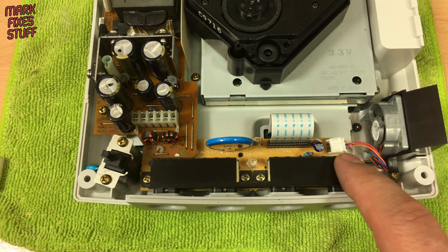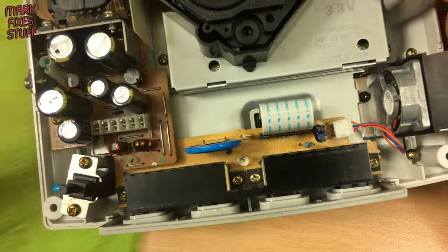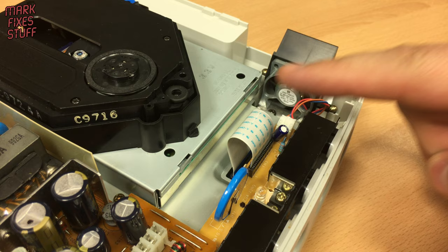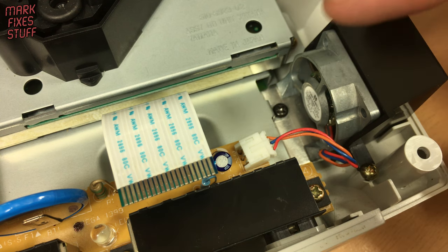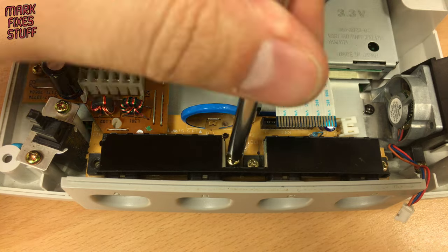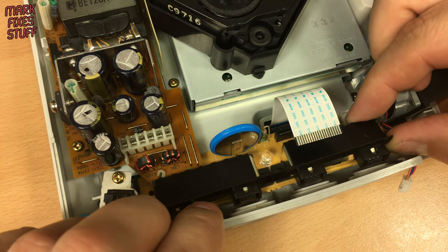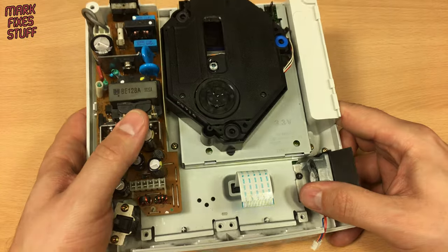We need to take out the controller port board. Pull out the flat cable — it's best to do this from the board side so it's not in the way when we're soldering. Next, remove the fan connector cable; this is locking so it might be a bit stiff. There are four gold screws. Now the board will come free, and the rest of the Dreamcast can be put safely to one side.